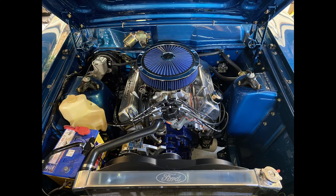The radiator has been mounted beautifully into the vehicle using custom radiator brackets so we didn't have to use the original Ford ones. All that's left to do is bleed up the cooling system, put oil in the engine, and put transmission fluid in the transmission — once that's all sorted we should be able to see if the thing will start. It's going to be awfully loud coming out of straight pipes. We'll do that in the next video, so please like, share, and subscribe. Look out for the next one coming up very shortly — hopefully tomorrow — where we'll actually try to start the beast.